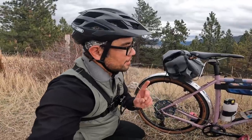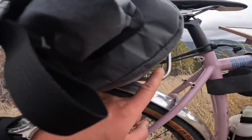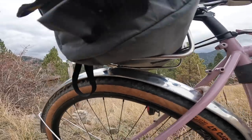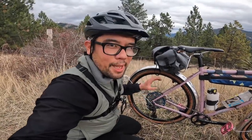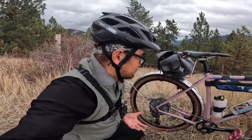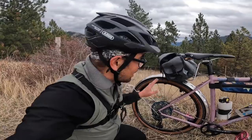The rear has started making some noise because I actually lowered the saddle down a little bit. I'm using the Erlen rack, which is a bag support, and it works pretty well, but when I hit a bump it's bouncing a little bit and hitting the top of the fender. This wouldn't happen with a rigid rack supported from the bottom, but with support racks like the Erlen or Carradice Bagman, you do have to account for flex to make sure the bag clears either the top of the tire or in this case the fender.